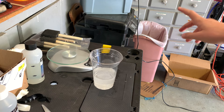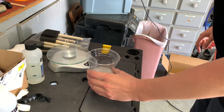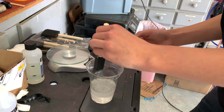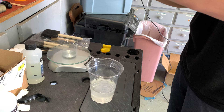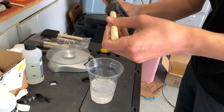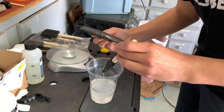This is about as many air bubbles as I could get popped. Now I'm just going to use a hair dryer with a piece of screen taped over it so it doesn't blow as hard, and I'm just going to use that on the actual parts to get the air bubbles out. Now I'm going to start coating the parts - I just hold it by a little clip and get a little bit of resin and start coating it. I realize I have way too much resin - I probably could have done four coats. This stuff is self-leveling so it should level itself out after being applied. I'm just dabbing it on there making sure to get it around all of the edges so that everything has a coat on it.